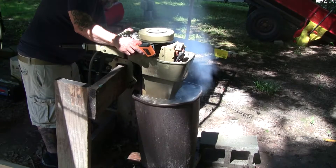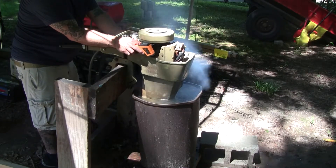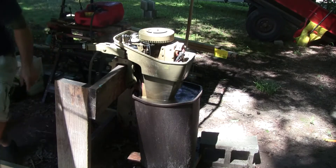You can see there's water coming out of it there, so the water pump and impeller are working fine now. Temperature's hovering about 140 — let it run another minute or two and see where it's at. Alright, so we're going to call this a success. The cleaning up of the impeller housing and the plate, sealing it up, getting the impeller in there in the correct position — apparently works. This engine does have to be immersed a little more than I expected, but that's okay. The temperature never went up over 140 degrees so it's cool — you can actually touch the block and it works fine. If you've enjoyed this video, hit share, like, and don't forget to subscribe. Thanks for watching.